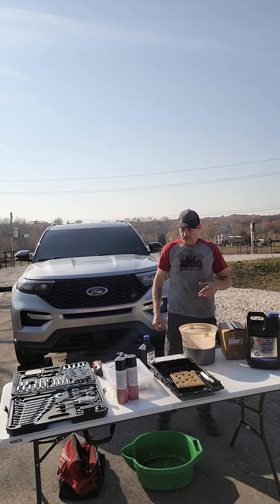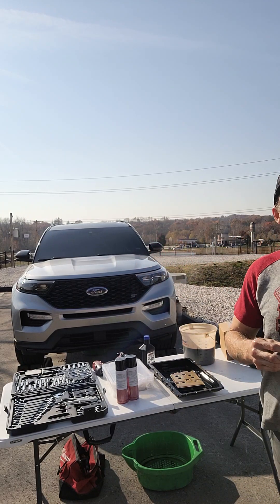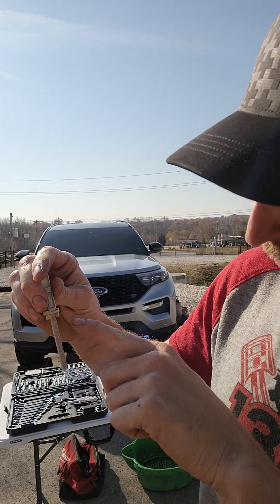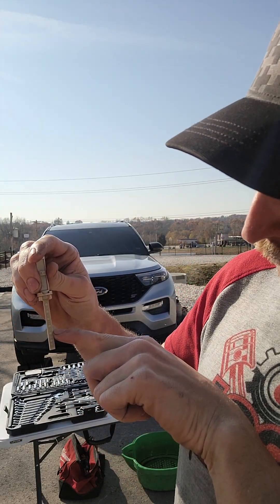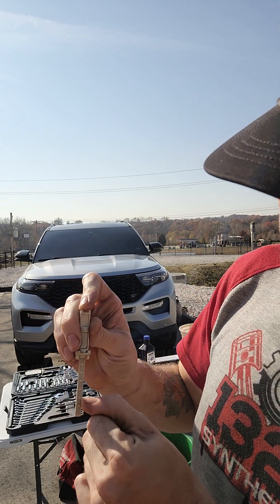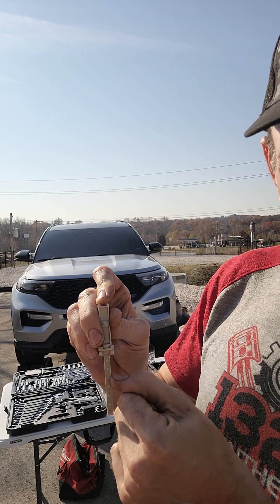Right there we've got just a fuzz over four and a half quarts. In our opinion that is just a fuzz too low — that's the minimum fill. When you're measuring with your dipstick at home, typically when it's four and a half quarts we find it's down here on the dipstick around four and a half to five. What we do is put five and a half quarts back in, which brings the level up to about two and a half to three on the dipstick.